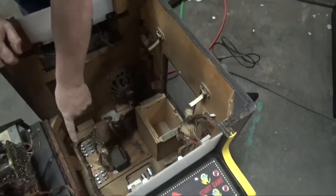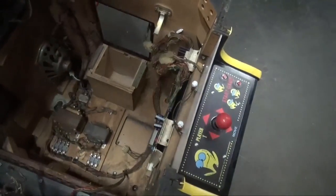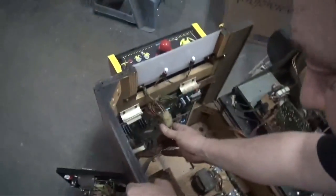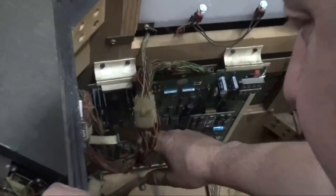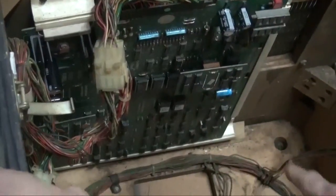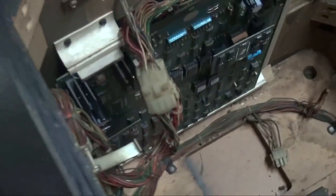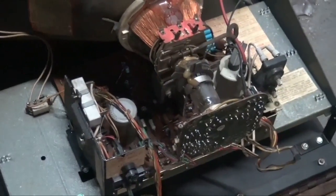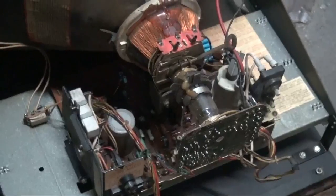We've put two new fuse blocks and new fuses in. We've taken the logic board out of the machine, and we've put new capacitors in. Zane in Electronics and Bob Roberts sells the cap kit. Two new caps here and here and under here, okay? When you're done, you always wire tie the daughter boards back in. And then, over here, the G07. The Pac-Mans all had G07s. Miss Pac-Mans had a crossover, some G07s and some 4900s. Okay, I think there may have been a couple 4600s. New flyback, new capacitors.